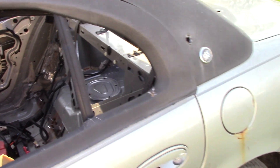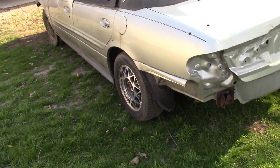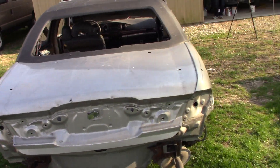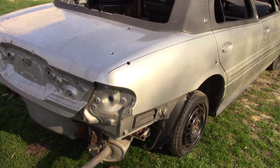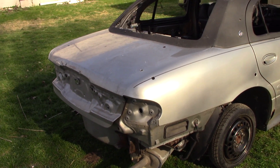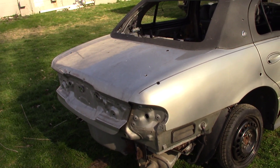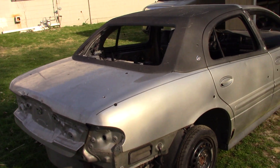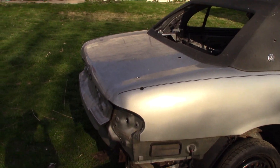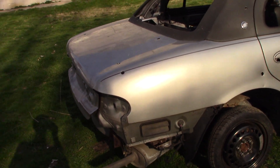Because the fuel pump works on this car, we're going to keep moving with the factory tank until that time. There will be no creasing on this car — very basic build. We decided to keep the trunk lid. Got a lot of input from you guys on different ways to wire it. I'm going to wire it down pretty good and let it pack in. I plan to use the front of this car a lot — the back is just for a couple hits to get it to roll. If it survives more than one derby, we can see how the back is packing in and decide if we want to ditch the trunk lid or shove it in further.